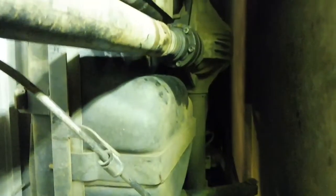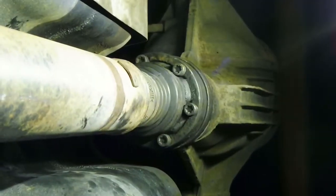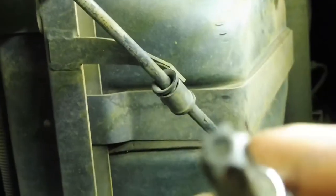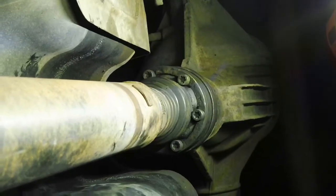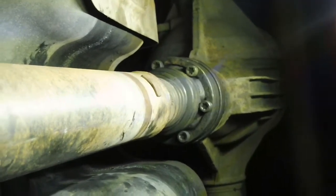And working your way back to the diff yoke. It's a bit strange looking. Hopefully that won't zoom in. Zoom. There you go. See that special fitting there for those bolts? They're not Allen key. Torx 50, or T50, it is. Must have. Don't try and use anything else, you just bust them up. If you're going to be working on 3rd gen Commodores, all those tail shaft and diff yoke setups, they're all these T50s. So yeah, get yourself one of them, you'll be sweet.